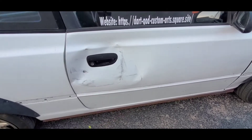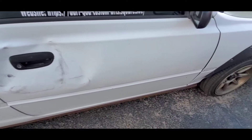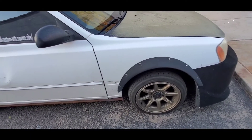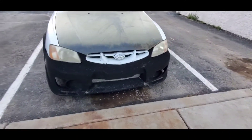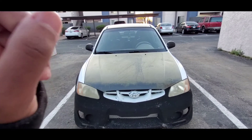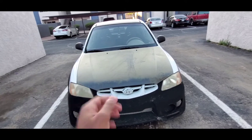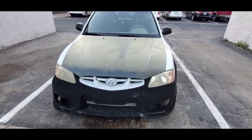I also had the old domain decal on here — that's coming off. So that's pretty much what she looks like. I've got the bucket seats in there. The bench in the back is actually from a Jeep — I had the latch that hooks into the Jeep cut, flipped, welded, and put into the seat, so they can still have access to the fuel pump. Pretty cool.